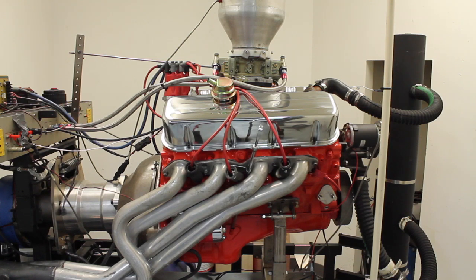We used a King rod and main bearing set in the motor along with a billet timing chain set. The cam is a solid roller — 260, 270, and 50 on a 108, with 630 lift at the valve. We took the oil pan; the customer wanted to use the factory pan, so we made our modifications to it and put a tray in it. We're running Maxim 1040 conventional motor oil with a Wix 51061 filter.